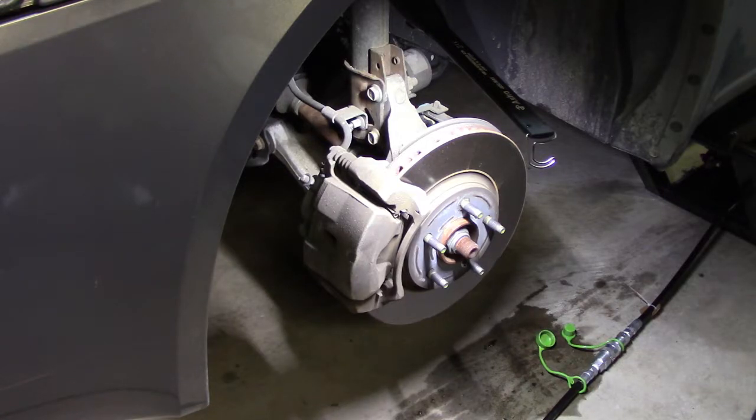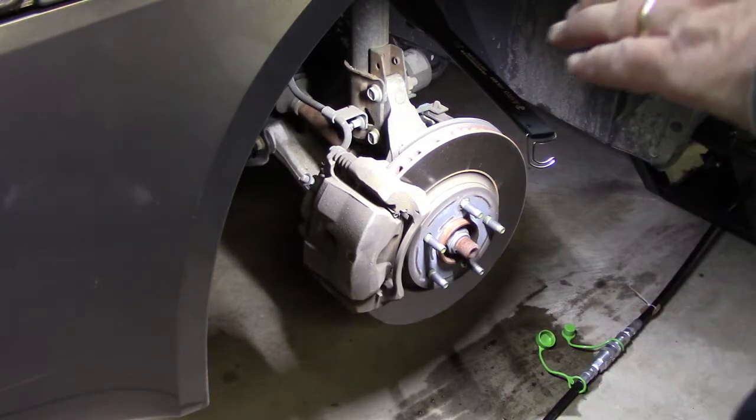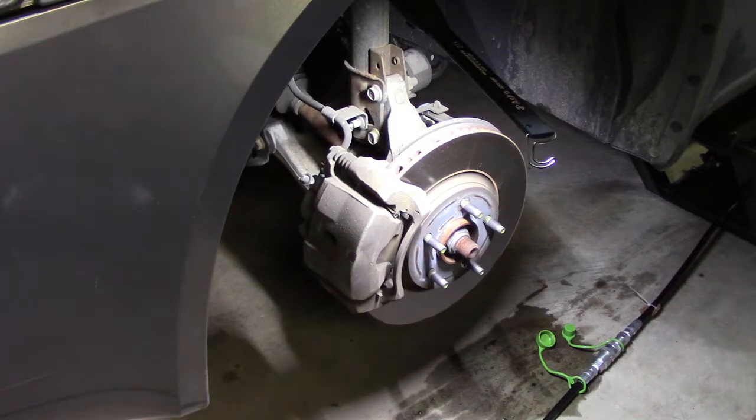I did discover something though. I worked on my son's 2008 Accord, and typically when you put it under the car, it'll move the car forward, say 11 to 12 inches roughly. On this particular car, if I put it so that it moved forward, the car had a tendency to tip. The center of gravity on this car, much like my Camry, had the same problem. Where the rear pad was, it'd be a couple inches off the pad, but on the front it was fine.